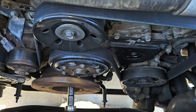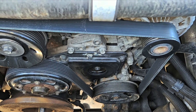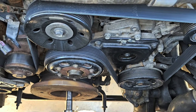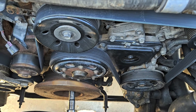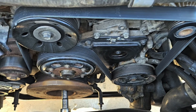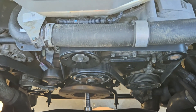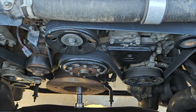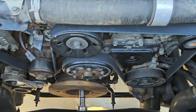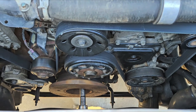In this video I'm not going to explain how to pull the nut off and get it off the chain gear to do the whole adjustment procedure — you've got to figure that out; there are instructions for it. But the phasing procedure is to make sure you line it up like this. Anytime you change the CP3 fuel pump, you always have to make sure it's timed correctly, and this is how you do it — they call it the phasing procedure.